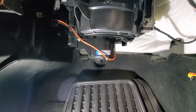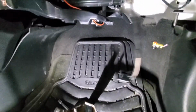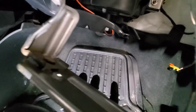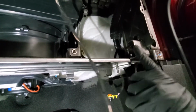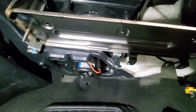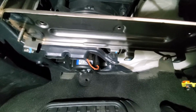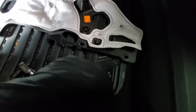Next we will put that plastic air channel in and that metal bracket. When you do the air channel, make sure that it's all the way in and attached to the main body on that side. And now we can do the bracket. At this stage we have our bracket bolted on both sides, 10 mil bolts, and also the air channel screwed to the bracket with the 7 mil screw. Now we will get the plastic shield underneath, 1, 2, 3 long 7 mil screws and 1 short.